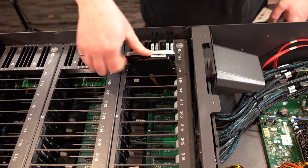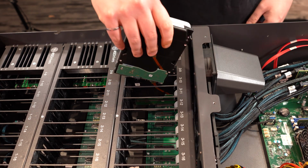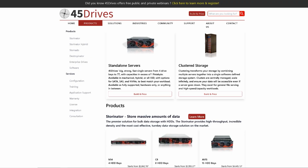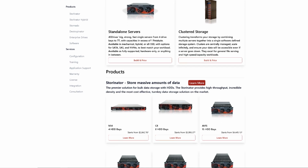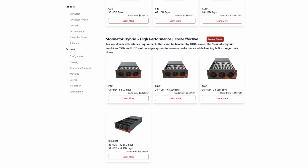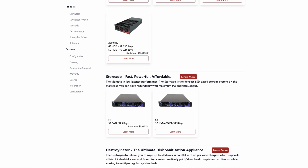The intermixing of drives gets really interesting in our hybrid server line because we'll always have some SATA or SAS spinning drives and we're going to have NVMe as well. So instead of having 2 separate controllers handling everything and different wiring that has to handle all of it, the backplanes for both the hard drives and the NVMe flash side of things will all be running UBM, because that way, that one standard controls everything. So while it's just NVMe now in our NVMe box, we plan on putting UBM into everything because we feel that it's a nice, convenient way to get a scalable, solid storage solution.